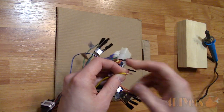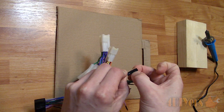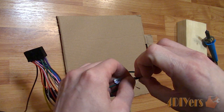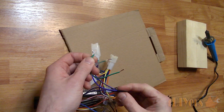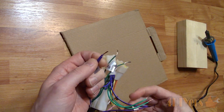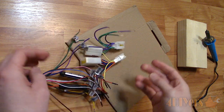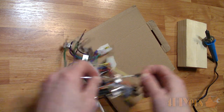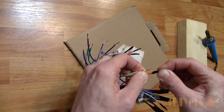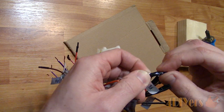All the wires which will be used were stripped. As a test run I matched up all the wires, twisted them together, and then wrapped the conductor in electrical tape. This is a great way to ensure everything is working correctly in your vehicle — if any mistakes are made after soldering then it's harder to fix. I purchased a vehicle-specific plug-and-play connector for the Tacoma. This method is highly recommended as you don't have to cut up the factory wiring, the installation is much cleaner, and if you part ways with your vehicle you can keep the head unit and reinstall the factory one. These plug-and-play harnesses can be purchased at your local auto parts store, some big box stores, electronics stores, or online. The plug-and-play harness comes with a wiring diagram and Pumpkin also supplies a wiring diagram. Typically the colors are generic but verify everything to be safe. Pumpkin also labels their wiring to make the process easier.